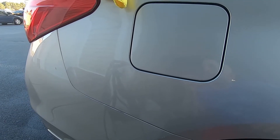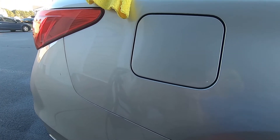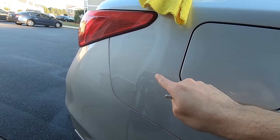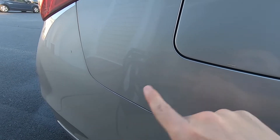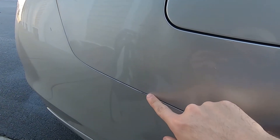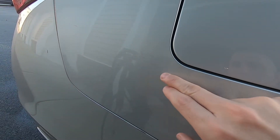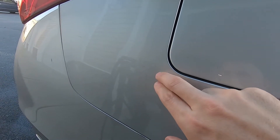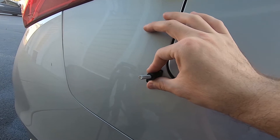You've probably noticed the dramatic change in lighting — this is about four or five hours apart from when I started this video, because I had to leave in the middle to go do something for the family. Just trying to get this knocked out before it gets too dark. Recap of what we've done so far: I used two different dollies and the small polished hammer, and I've gotten it to where it is right now. If I push, you hear it pop but it pops back out — that's good, that means I've pushed the crease out enough that it's now holding the pressure. The only thing really left is a small portion up here that is still dented in, and this is where the dent repair kit comes into play.